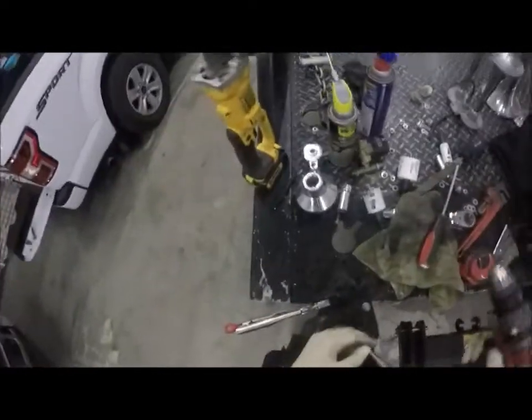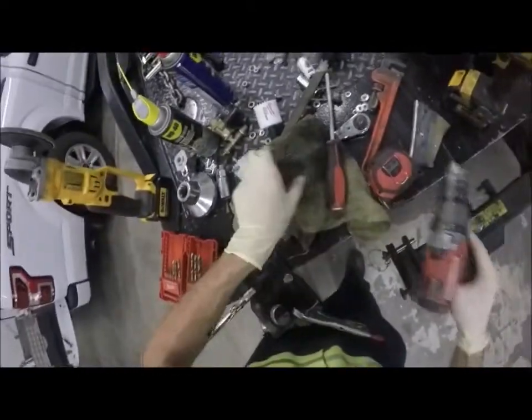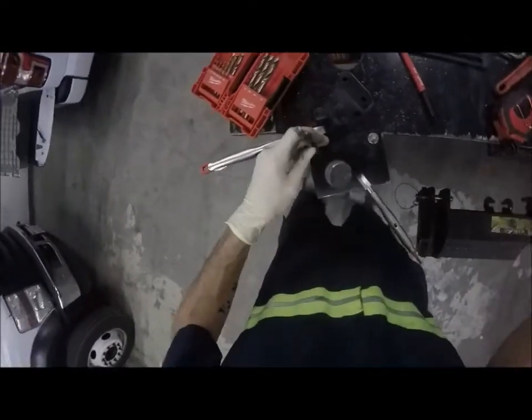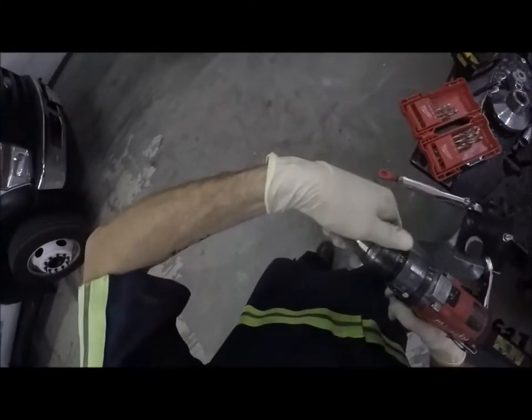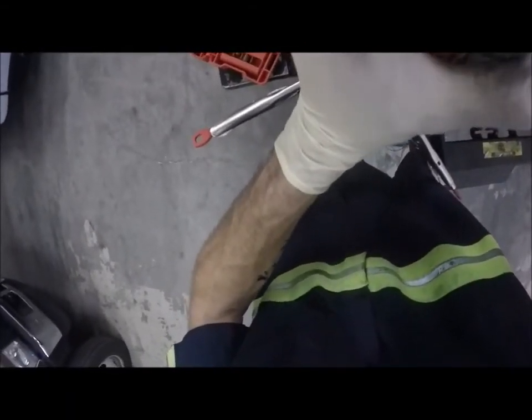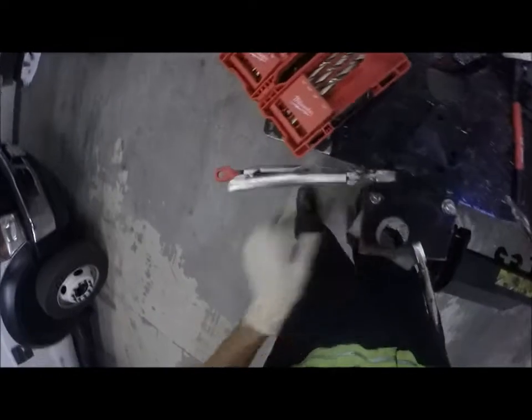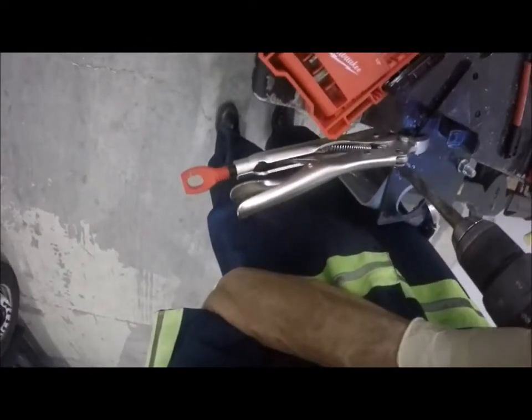Yes, we are. Okay, where's my drill bit case? Half inch bit's already out. Here's the deal though. Half inch is not the size of these holes. It's just a slight bit bigger, which means unfortunately my bracket here is going to get a half inch. Its hole is going to be widened a little bit too. I don't have a metric size drill bit for this. The whole reason I'm doing that is so I get that center hole.